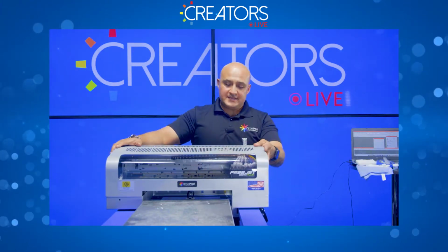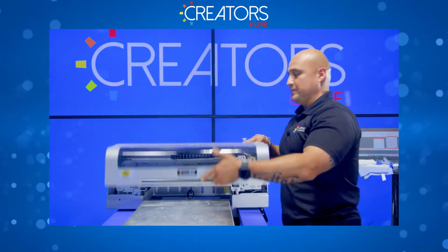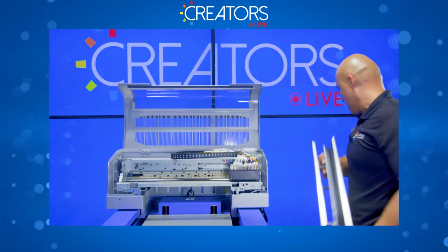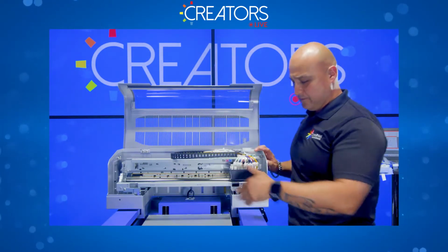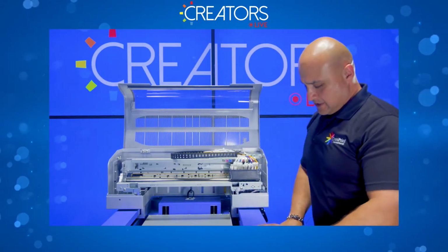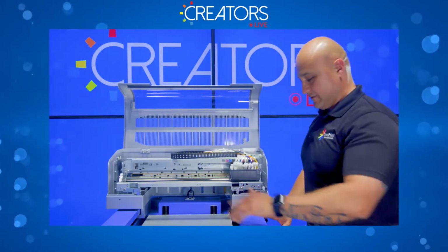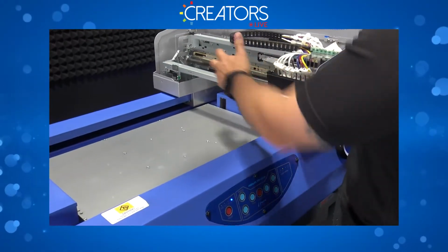All right. So with that being said, we're going to go ahead and jump onto the regular maintenance. So let's say you're done for the day, after printing for 8 hours or 5 hours, whichever. The very first thing that you would like to do is, of course, prepare your area. Go ahead and remove the platen. You want to go ahead and lower the table all the way down. In this case, it's already down. Then what you want to do is press function up to move the carriage off the capping station.